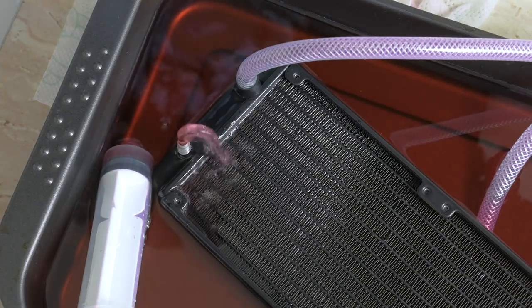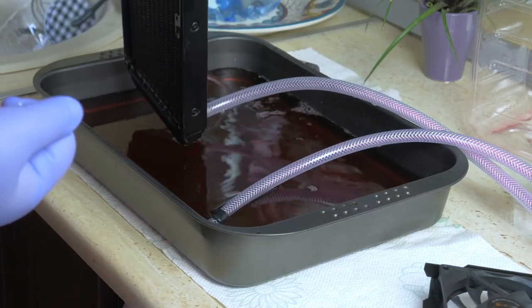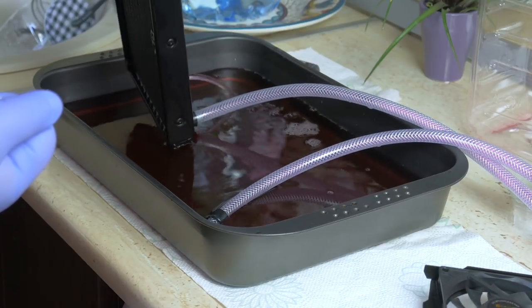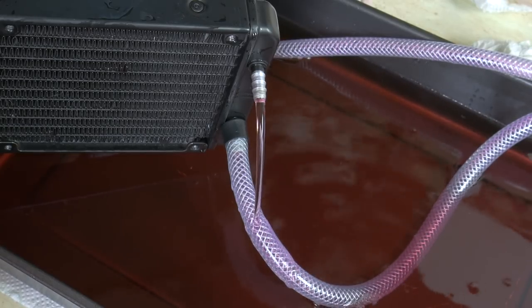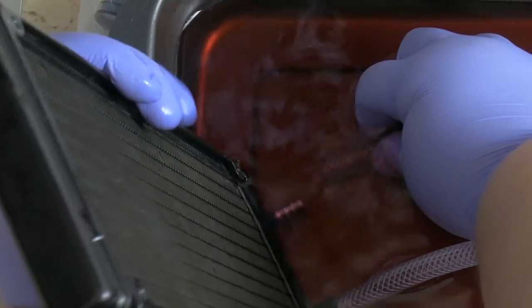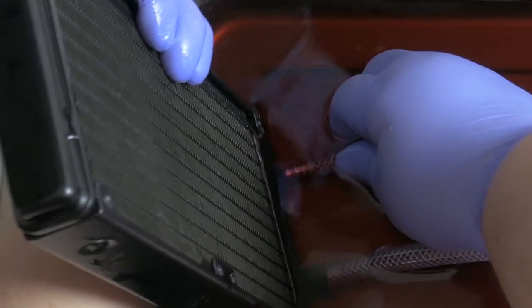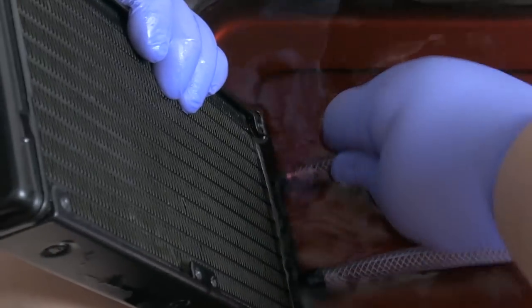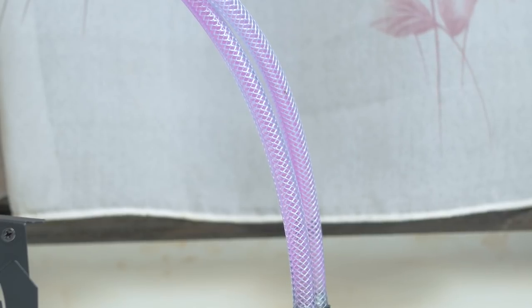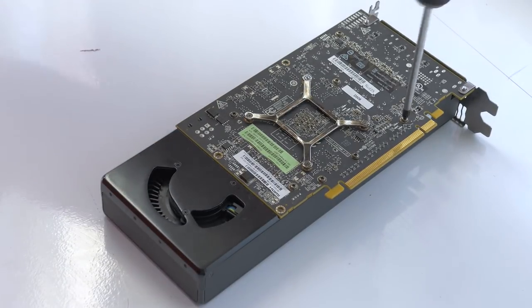This will ensure a fairly low amount of trapped air, so go ahead and power on the pump now. The free barb on the rad should be evacuating coolant freely unless your rad was dirty and you have a clog now. Next step is extremely important before sealing: move the radiator in every position possibly imaginable until, regardless of how you place it, the coolant coming out exhibits a laminar type of flow. If you just leave it in one position, the flow will settle, but when you seal it you're going to have massive air trapped and this will destroy the pump. And it's finally time to seal this off — you do this while submerged, both the free rad barb and the pump inlet. There shouldn't be any bubble noises in the pump before you do this, so make sure it's quiet and working as intended. If you do this last step correctly, your AIO loop is sealed and working again. Don't worry if there's tiny, minute air bubbles still trapped — it's okay, and even factory-sealed AIOs have some. Chances are that the top of your rad will always be higher than the pump, so these won't affect anything in the long run.